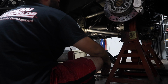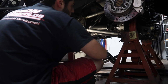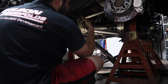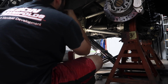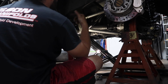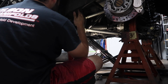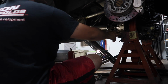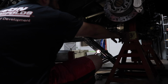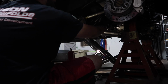Alright, so there was that bar change. So that lowered our instant center. Yeah, and it moved it forward. Made it longer. Yeah, lower and longer. So really, if your instant center is higher, for instance, if we move that top bar up, that would drop our anti-squat and move our instant center forward and higher. Or you could have done it by bringing the bottom bar up in the back, and that would have, it just wouldn't have been as much. Yeah, you're right. This 4-link stuff is nifty, huh?